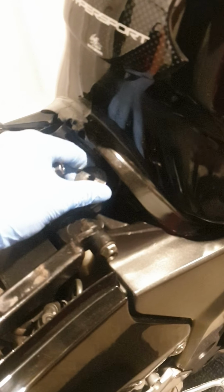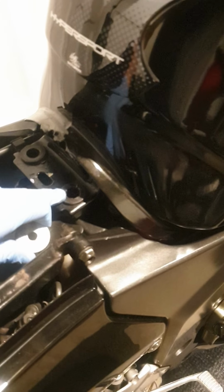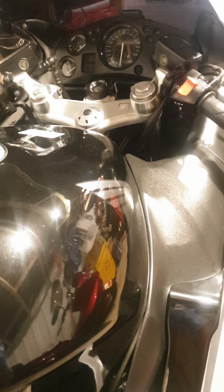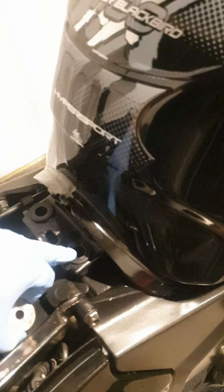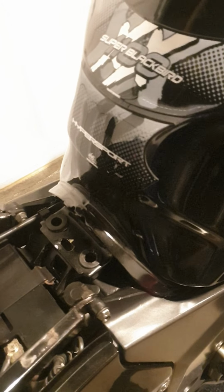Okay, once you've undone them, you want to take the bolt out, then you want to take the collar out as well, but leave the rubbers in. What we're going to do is, next shot you'll see, I'm going to lift the tank at the back a bit, then slide the tank back so it comes off its rubber bung at the front. I'll show you that when the tank's up. Then I'm going to put the tank back down so the rubber bung is underneath the bar at the front. And then I'm going to put these bolts back in loosely, but obviously don't tighten them right down. And then we're going to hinge the tank up and prop it up. I'll show you it next video.